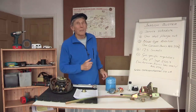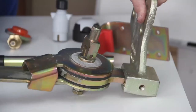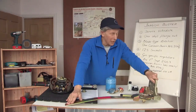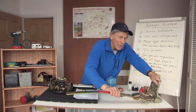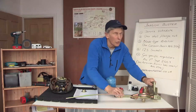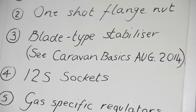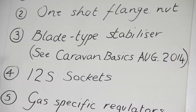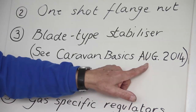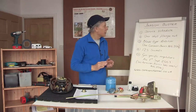Now let's talk about blade-type stabilizers, because I've got one here. The blade turns back and forth as the caravan goes around corners — that's the tow bar end, that's the caravan A-frame end — and to stop it turning too easily you just tighten it up like that. You can find out more by going on the Caravan Channel website, looking under Caravan Basics, and finding the August 2014 videos — there's a whole section on stabilizers being compared.